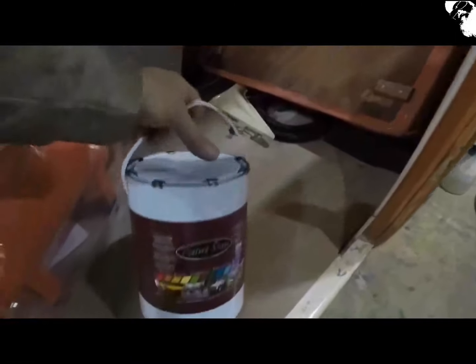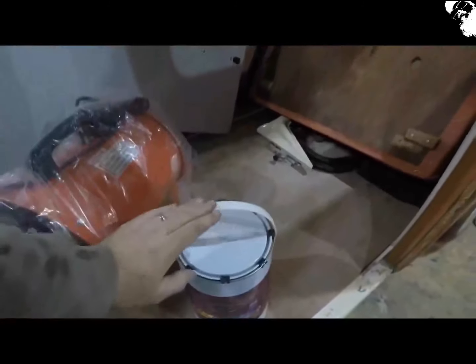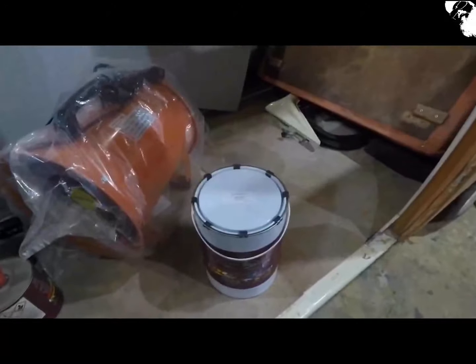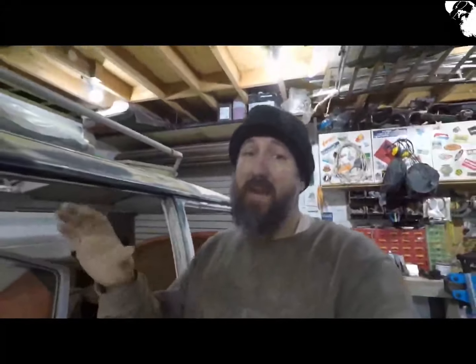In the meantime I might spray all the little bits with the electric gun I've used before. I'm also held accountable for fulfilling my pledge for the VDub Run '21, getting a little bit of paint on there. I've gone and bought a huge roll of plastic sheet to basically cover the whole place. Throughout the painting process I'm going to be using Paint Man paints from here in the UK. I've only bought the primer and undercoat so far along with thinners etc. I'm going to be using an enamel paint. The reason for only getting a little bit of paint done on the bus now is purely weather related - it is so cold and I just don't want to chance leaving the paint to do its own thing in this climate.